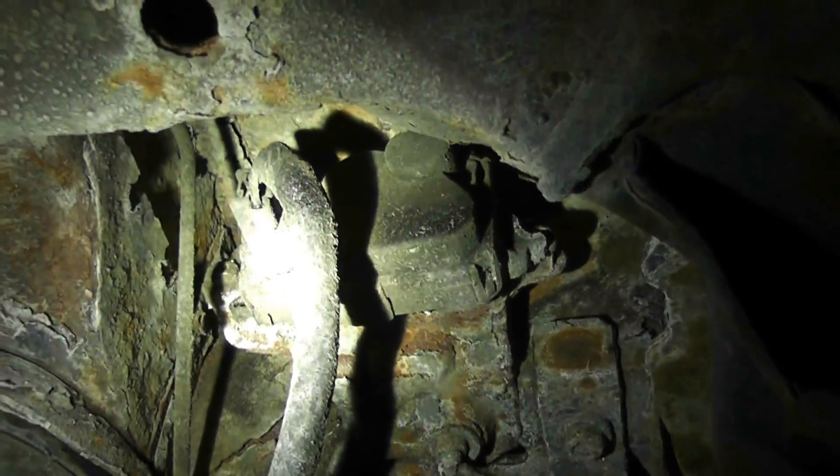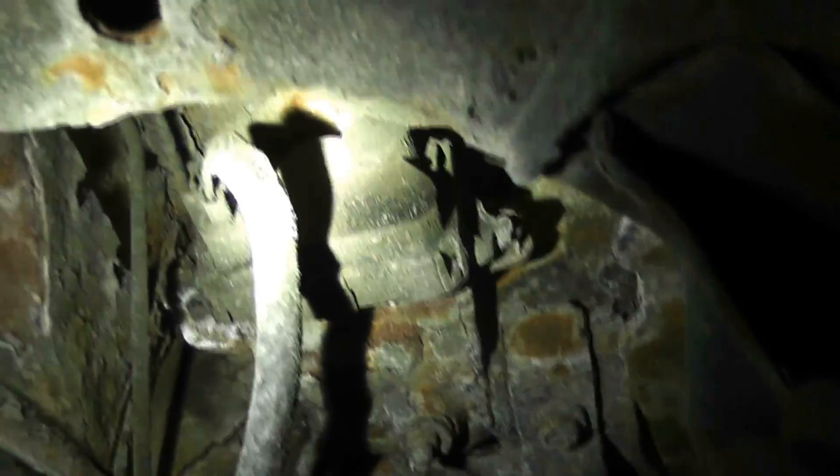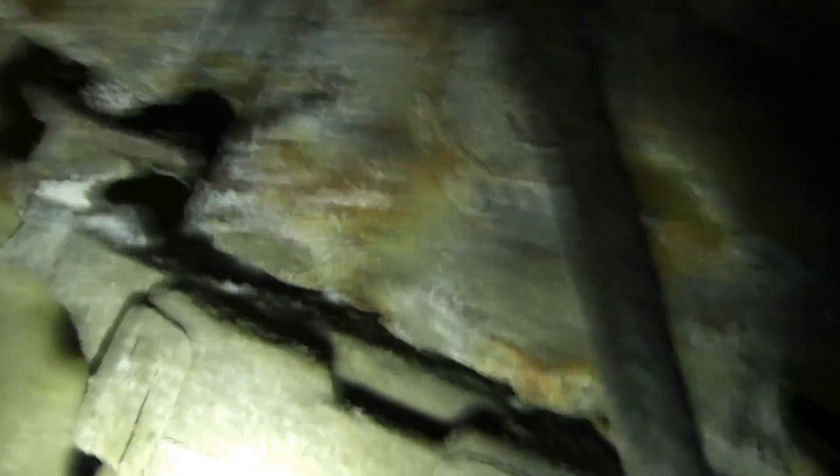Then we get underneath here, and there is our fuel pump driver module. You can pretty much see how rotted that is. And if you get closer, you can see that's broken off. There's a hole in the back of it because it's just die cast. So there's our problem — it has rotted through and the little electronics are all shot.